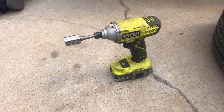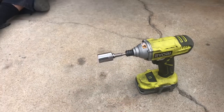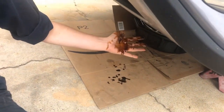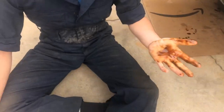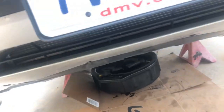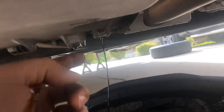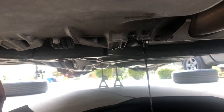The impact driver works pretty good to remove wheels, but it will not set enough torque for the road. If you're using an impact driver, go back and torque the lug nuts properly — with an impact wrench you go to about three ugga-duggas. Aaron has properly changed the oil — got a dirty hand. When you change oil, that's like a rite of passage. This car is very easy to do — you barely have to jack it up; the drain is on the back side and the oil filter is right there.